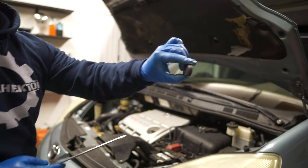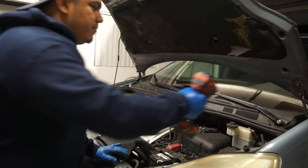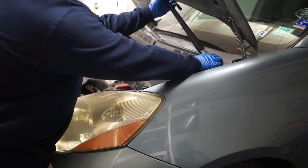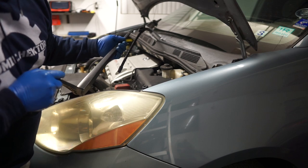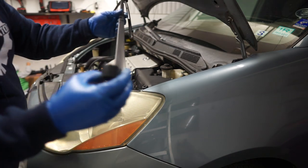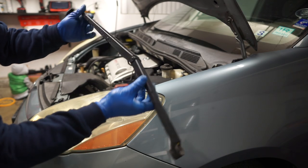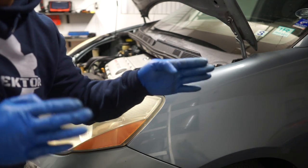Start off by taking these little plastic covers that go on the wipers. I'm gonna use a 14 millimeter with my Milwaukee on these nuts right here — two nuts for each wiper. To take them off you're gonna have to bend them up here, that takes tension off this part right here and you can just pull it off. You want to keep in mind the position of the wiper — I'm gonna leave that little bit of dirt there on the window so that when I put this back, it goes back in the exact same spot, not too high or too low. Driver's side wiper goes down on the driver's side floor. Passenger's side wiper arm on the passenger's side floor. You want to be organized so you don't confuse left and right.